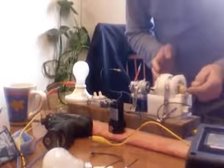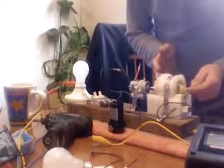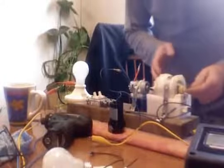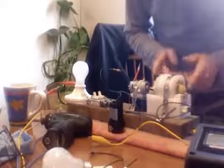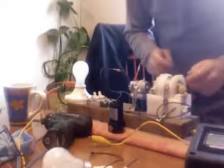But if you want to know where to get a better one, go to any hydroponics shop or a pond pump. They have magnetic drive pumps, actually hydroponic shops, magnetic drive pumps. Here in Edmonton I can buy one for about 139 bucks. I'm going to go over and pick one up. And they have bearings in them, so you haven't got this nylon bushing. They won't handle the high speeds, they melt.